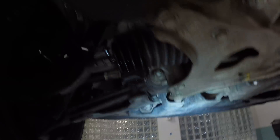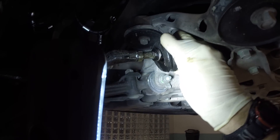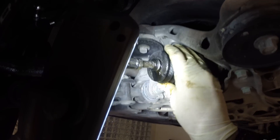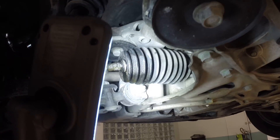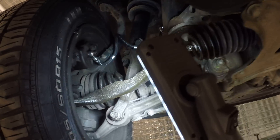Some of them are fairly obvious, but I just want to show you what these things look like. First of all, there's a pretty good leak — all this fluid down here on the ground. This is power steering fluid and it is coming from our rack and pinion assembly. You can see this boot — it's just pooling up in there. This boot is torn open, and you can see the inner tie rod end up inside there. Because that boot is torn open, dirt and debris has been able to get up inside and get into where the seals are that seal that rack gear. The seal has been destroyed and you can see it's now leaking.